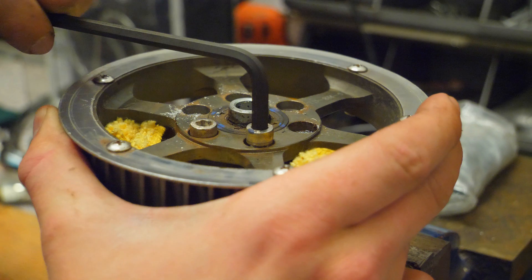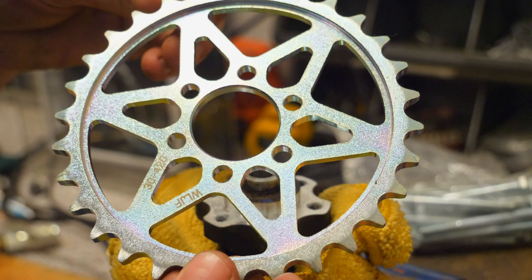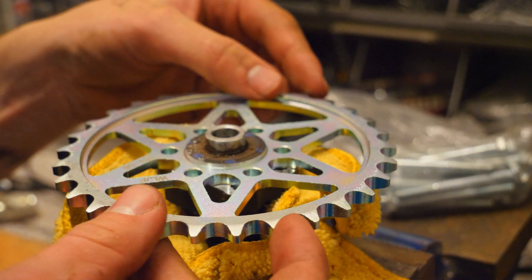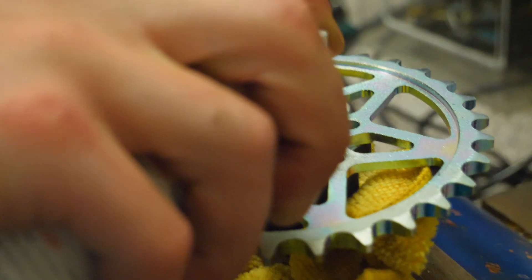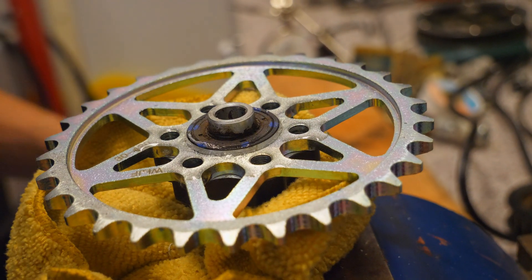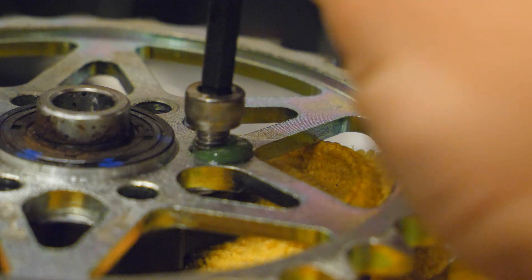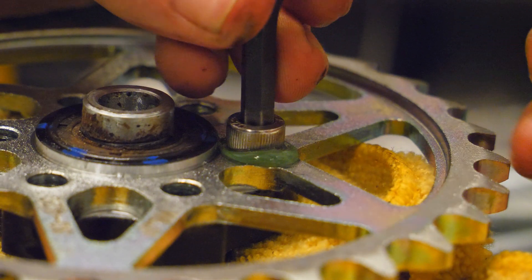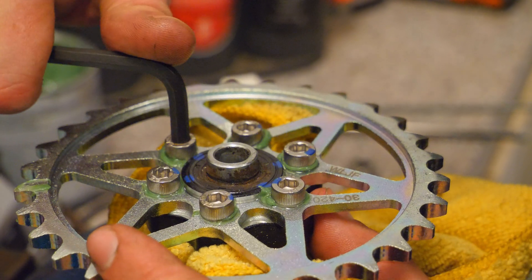Next up you're going to have to swap out the other pulley that's on the hub. To do that I put it in a vise and just used an allen to take these out — they were really gunked up and had some sort of weird loctite on there, so be aware. Once the old one is off go ahead and throw the new one on there — make sure to put the raised edge down, and it's pretty simple. The threads in here are pretty gunked up so I'm spraying some lubricant in there and cleaning it out with the old bolt just to make sure everything goes back in nicely. I used some standard grease when I threaded these back in just so they went in easily and got the proper torque. Once you have all of them in, do one last tighten on all of them and make sure it's on there good — you don't want these falling out on you.